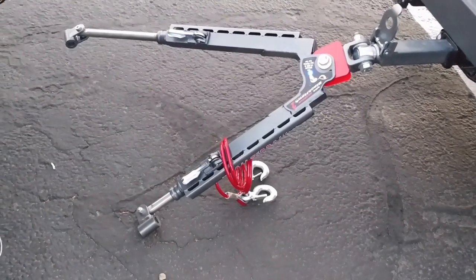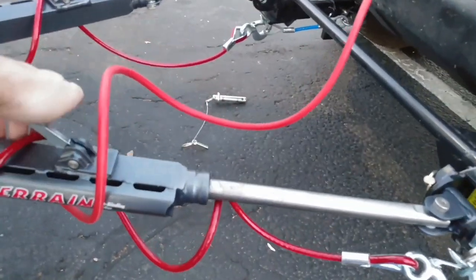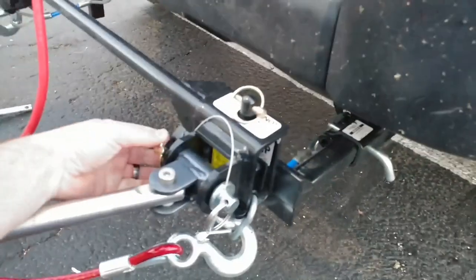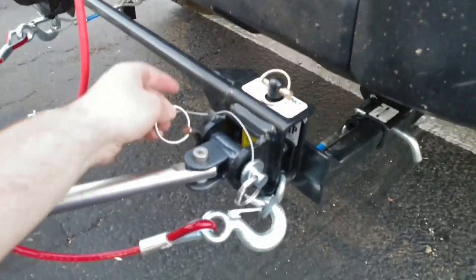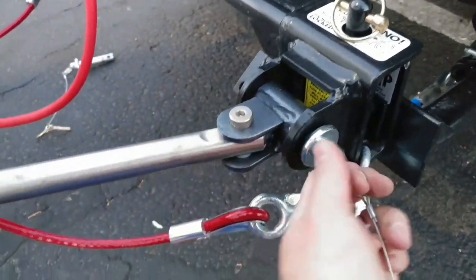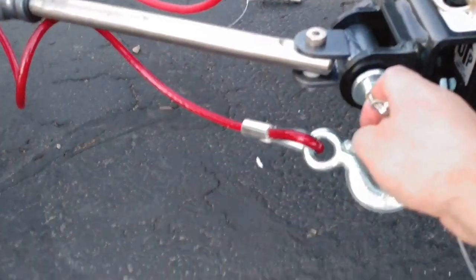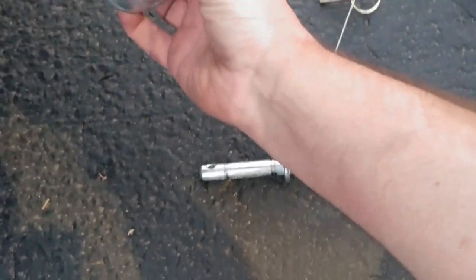The tow hitch connection could be easier to undo. The key to that is getting on a level surface and making sure you're straight. Sometimes these things can be a little hard to release — usually it's because you've got tension between the FJ and the tow hitch. Release the tension by moving the vehicle into neutral or back and forth. Sometimes it takes two people: someone in the vehicle driving it forward and back in idle — don't push on the gas. Then these pins go right back in.